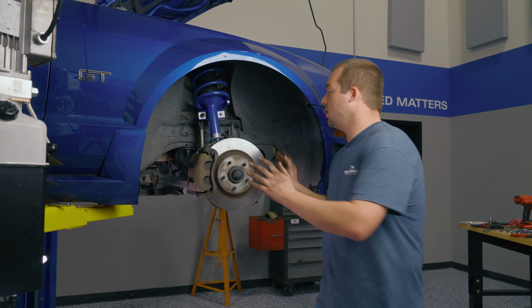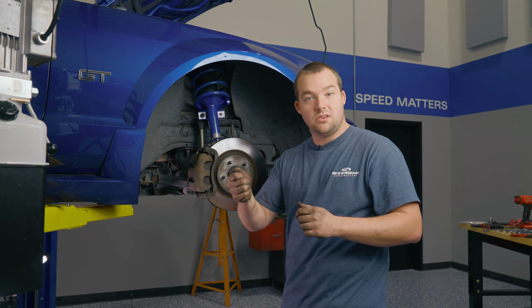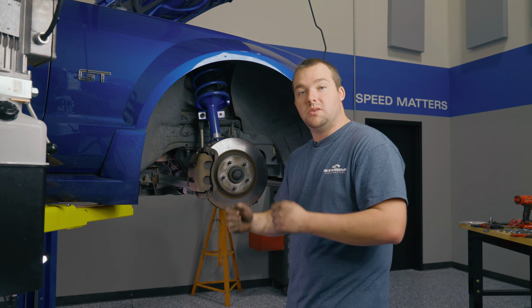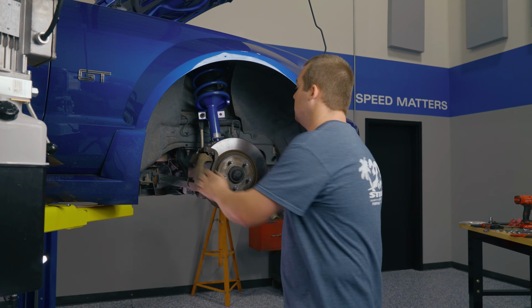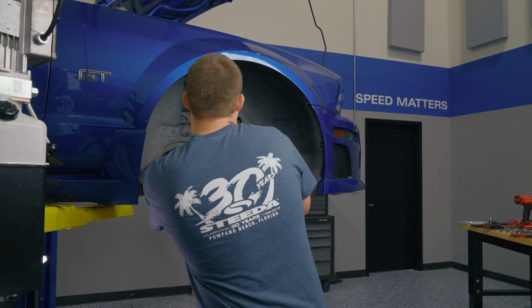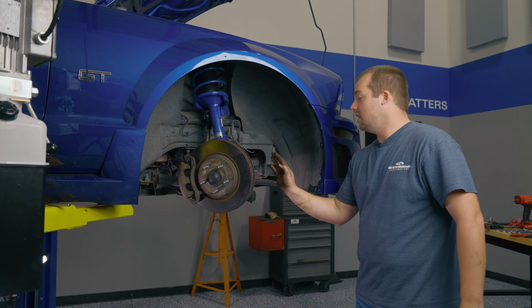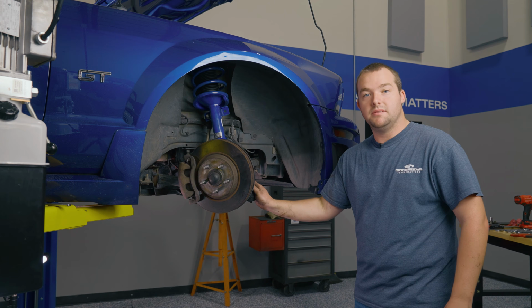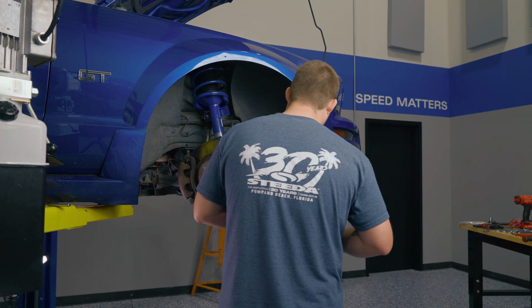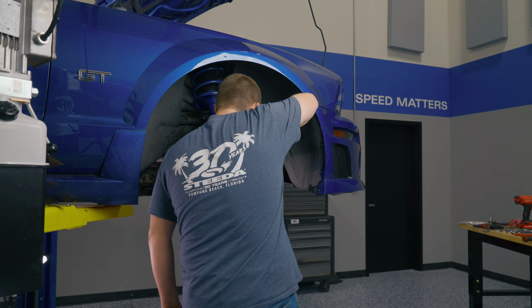First things first, we're going to go ahead and turn the wheel, and it may be locked on the inside, so you may need to turn the ignition, unlock the steering wheel so you can get it all the way over, but we've already done that, so go ahead and turn everything over to the right-hand side. Then at that point, we're going to start with our bump steer kit. All right, a pair of needle nose pliers and side cutters. Go ahead and bend these nice and straight.